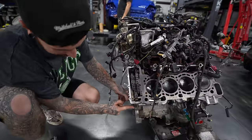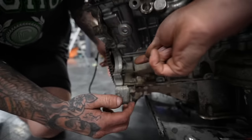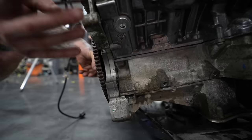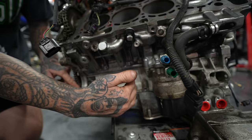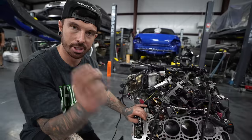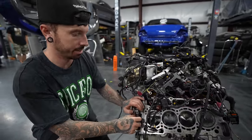There's one bolt which goes that way, and another bolt which goes where? Goes that way. Here. No, into the gearbox. It comes at the bottom here. Right, and goes into the gearbox. These two bolts are going to be hard to get to. The second thing, the starter motor is about yay big. So to get it out, past an engine mount is going to be another challenge. Another challenge after that is getting a starter motor to replace it.